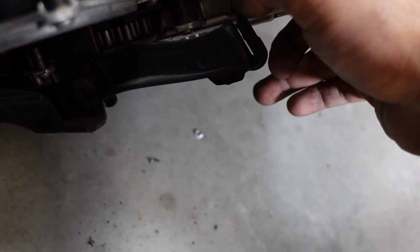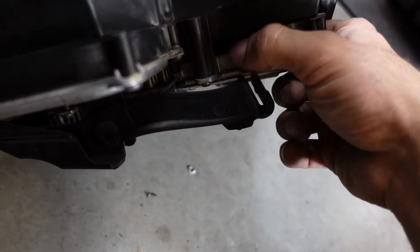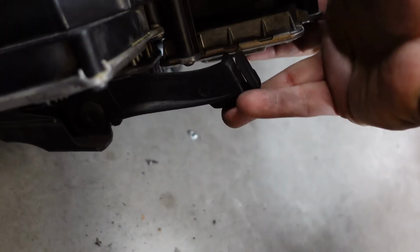This is holding on to the car. I guess I wouldn't really call it a female-male, but just a lever or a clip. And this just goes up and down, and that is all that's required to take the headlight off. Really not too bad. I guess the worst thing would be to take the bumper off, and if it's an original bumper, it's a little bit harder because you have to take the water guards and all that garbage, which mine doesn't really have right now, so I'm good to go.